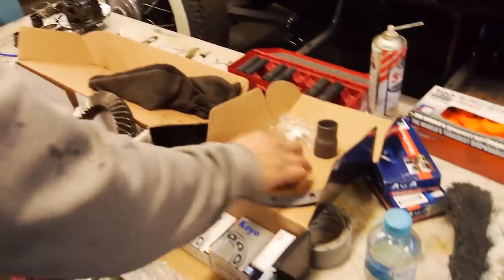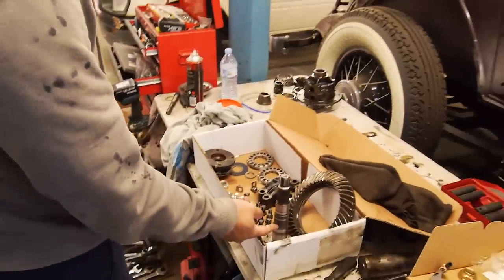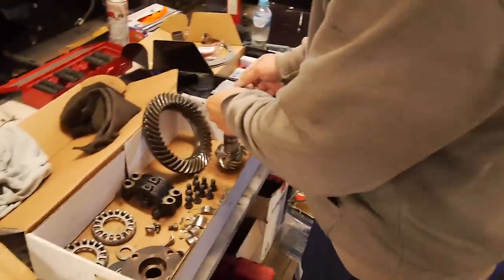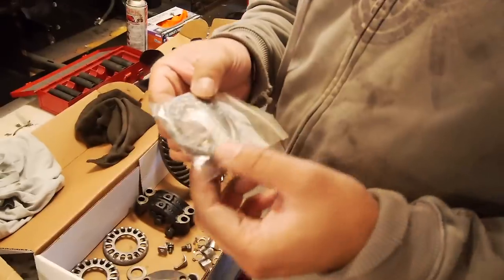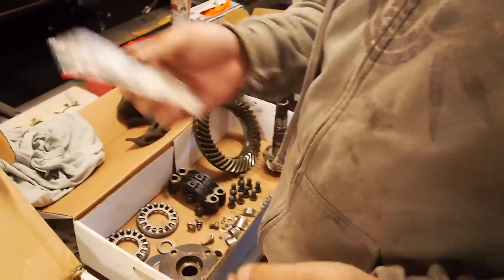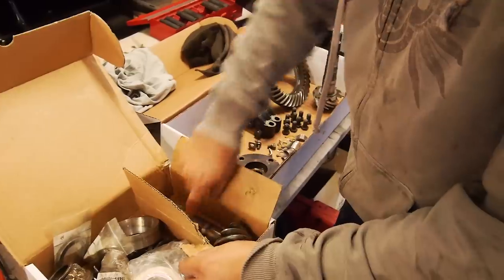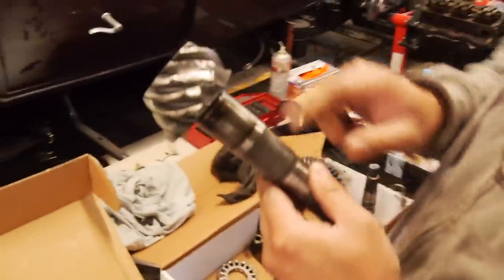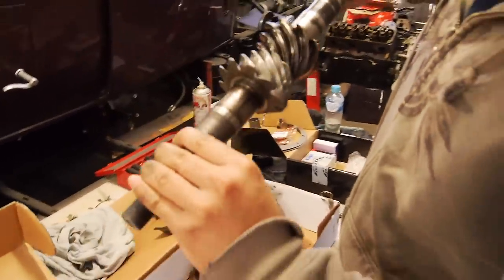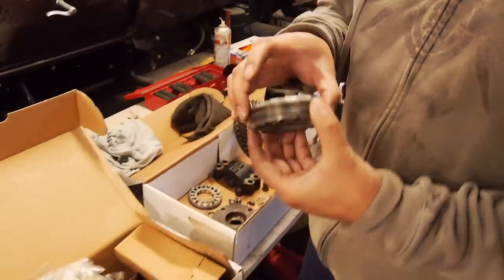And you are missing one of the little pieces, because mine's the same setup, but there is an oil control ring in between the two bearings. This piece here runs in between the pinion gears, like sits somewhere in there. I never had anything. So this one got a little bit damaged, so I ordered a new one, but it's still sort of okay. But you want to have a look at the EPC, because that is there. See, that's my pinion. Do you reckon we can use that? I think it's a different gear ratio. We'll check those. They're the same. Yep. Pitch is the same. Diameter is the same.